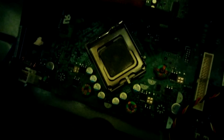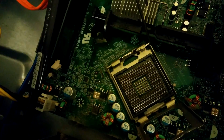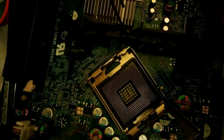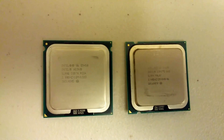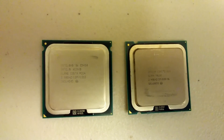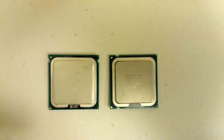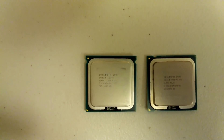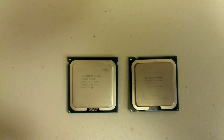We just need to pop this CPU out and set it aside. The next step is interesting — according to the videos, you have to shave off with a razor these two little guide pins here on the side. Here are the two CPUs side by side. You can see what I mean about needing to remove some of the plastic on the socket. The original Core 2 Duo has the notches on the side where the Xeons have them on the top. Pin one is in the same place, indicated by the arrow in the lower left. So I need to shave off the extra plastic so that it'll fit.